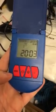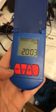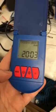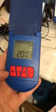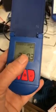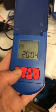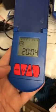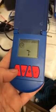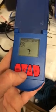Now we're going to show you how to program this. Most of these come out pre-programmed, so you really don't need to touch anything except setting the time. But if you want to adjust the program, this is what you do: when it's showing start at the top with the correct time, hold down the mode button until the time flashes, take your finger off, then hold it down again until it says STR — that's the time the timer is going to start operating from.